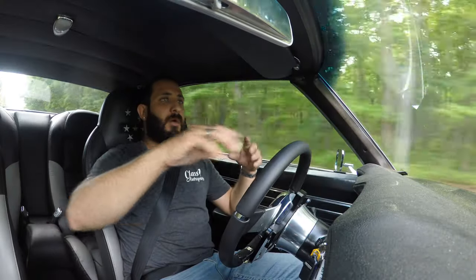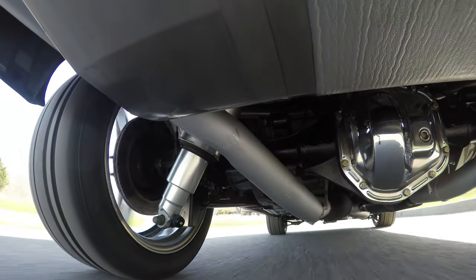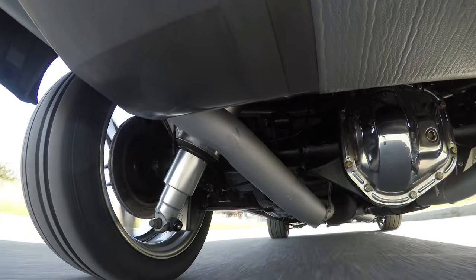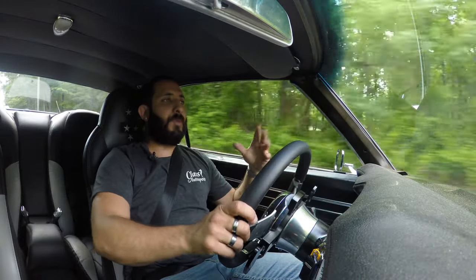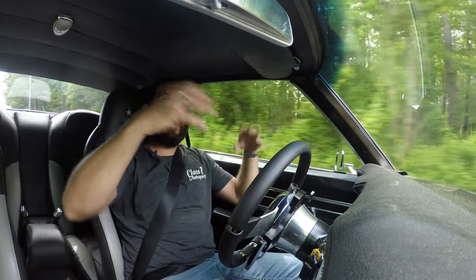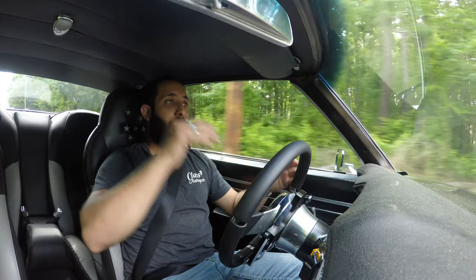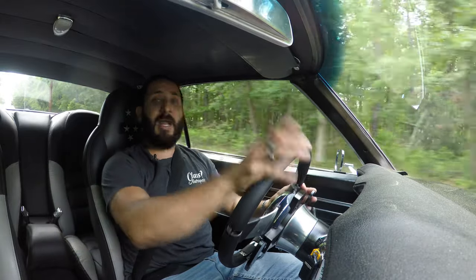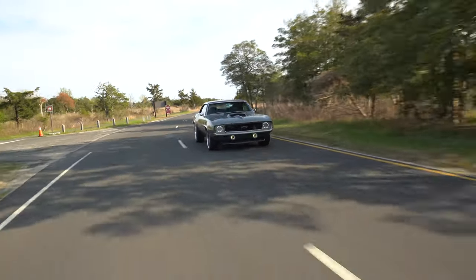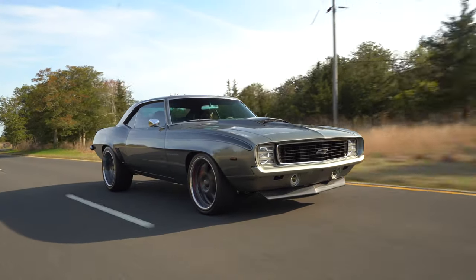The full rear end features a four-link suspension. Normally in these vehicles, if you accelerated quickly you'd get axle wrap — it would change the angle of the driveshaft and cause a hop. The four-link keeps that rear end straight as an arrow, so when you mash on the gas the tires spin and you're out. The 3.54 gears in this bad boy are all held in by a Dana 60.